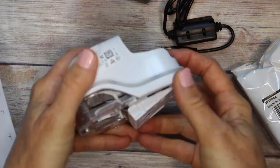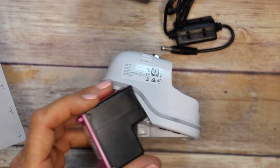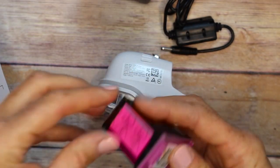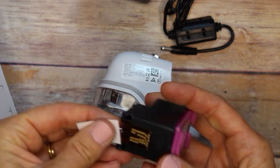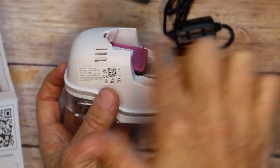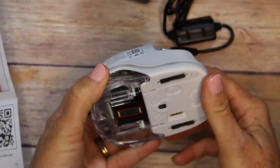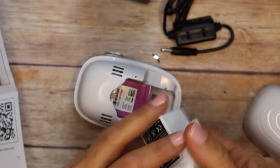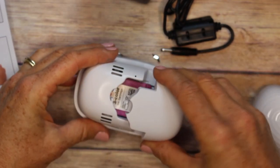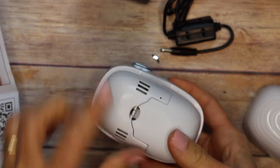You can see it's basically hollow inside, and there's a little flap on the bottom you have to push out — it pops down and allows you to load the ink cartridge. It's a three-color cartridge; you remove the little plastic covering over the printhead, insert it all the way until it clicks, making sure it's flat. Then snap the bottom back up and pop the ink cover back on — it clicks into place, very satisfying.